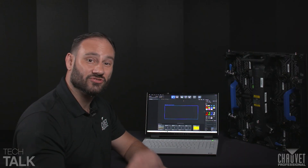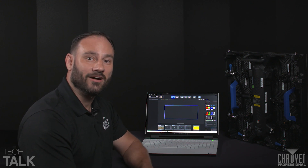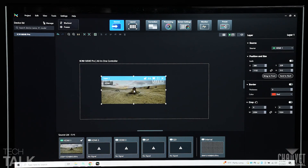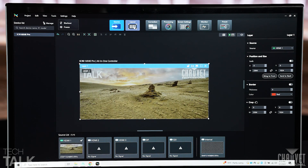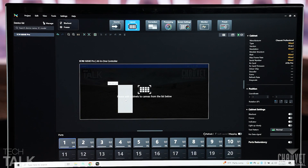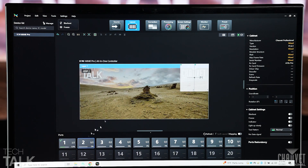We're so confident this is an extremely easy system to use that I deleted all the mapping and scaling data from our wall and we're going to show you how fast it is to get it up and running. When you open the VMP software, select your MX40 Pro processor on the top left. In the source window, drag your video input into your canvas, press the little icon to go full screen, and we're done. Moving on to the next icon on the top left — your layout — it will auto-populate all of your ports on the bottom. Select the first one, move it into the canvas, move it to the top right, press and drag, and you're good to go. Continue on to your next port.